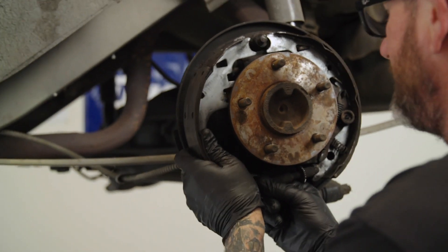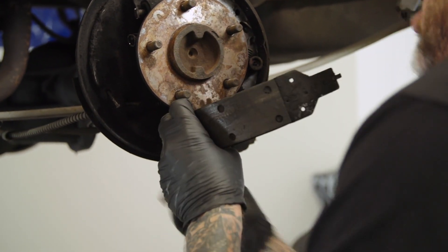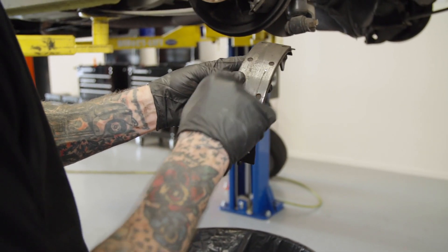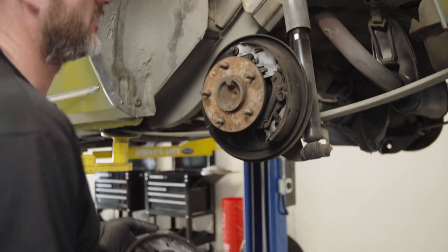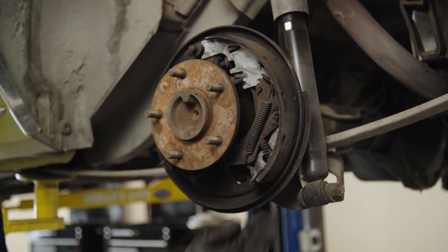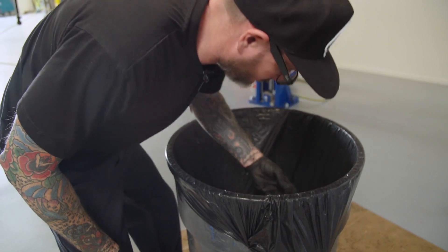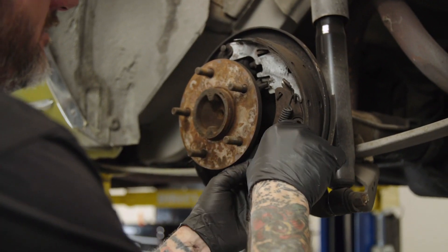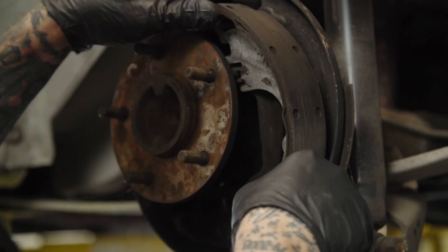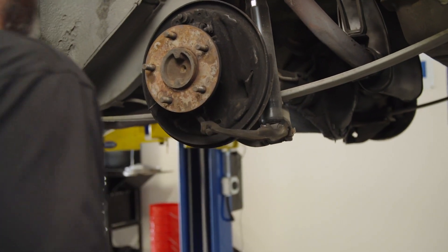Here's your adjuster down here. Another spring — look at all the cracks in here. There's a primary and a secondary brake shoe, and the smaller lining brake shoe goes on the front, just for reference. This spring here is all part of what adjusts your brakes. And then your e-brake. There we go — I'm going to go ahead and spray this down again.